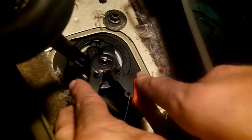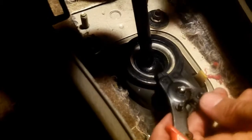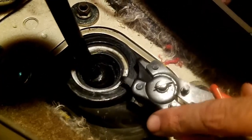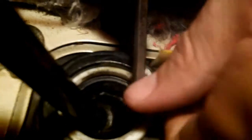Do not just yank this whole thing up, otherwise you will rip the rubber around here. It is best if you lube this whole entire shaft up with silicone. If you are in a pinch, use some PB Blaster on it — just a little bit, let it run down, lube up the whole thing. Now that you can kind of see in here, you have access to your snap rings. Snap ring pliers in here. After you get the main snap ring, there is a Teflon coated white ring that also needs snap ring pliers. Once you get that out, the whole ball will just come right out. Work it out — and off she comes.